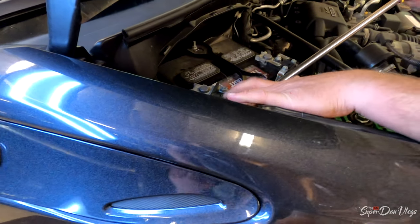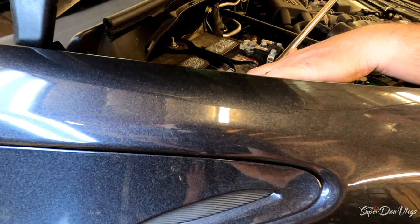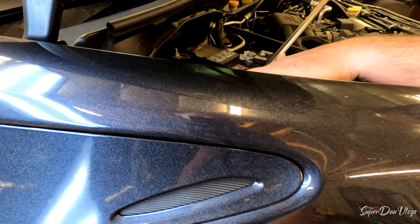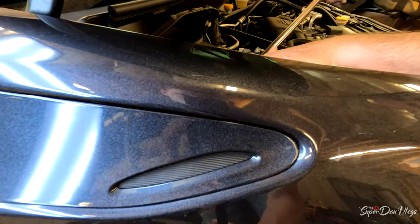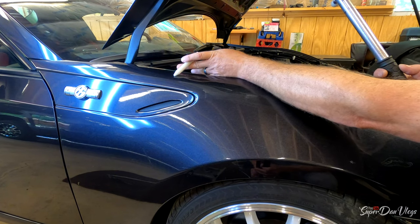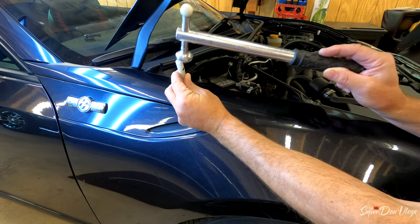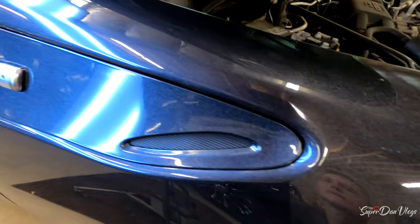When I start to push behind it you can probably see the metal move. I'm just barely pushing on it, but if you can see the dent right now, give it a second. And if I get a tool right in there in the right spot, I'll do a little push — a couple little pushes really. And that's it, it's up and out. That came out a little bit on the high side, which is fine, because now I can shape it from the outside with a nylon knockdown and blend that little high spot away. That was just one of those teeny tiny little dents.